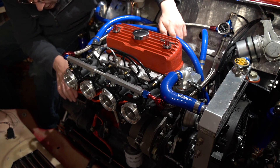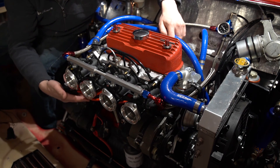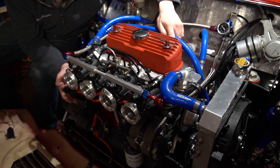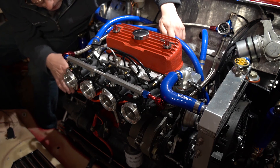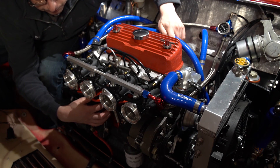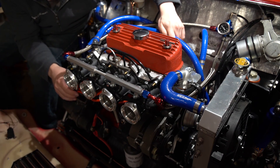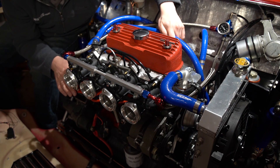These HT leads — I spent a while trying to find a set of HT leads that would suit this setup properly. Weirdly, the set that I ended up with are actually an MPI mini set. They just happen to line up properly. On the MPI, the coils are here. However, due to the placement of these plugs, which are underneath the throttle bodies, they just happen to be absolutely 100% spot on.